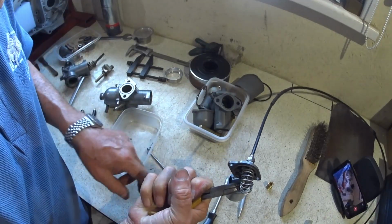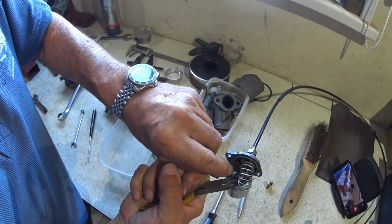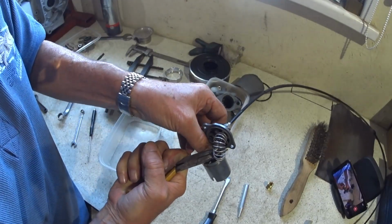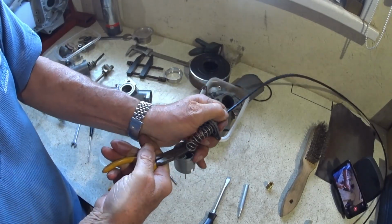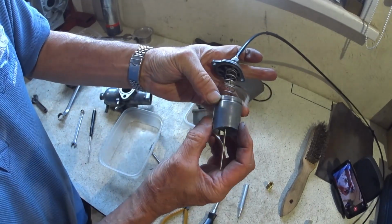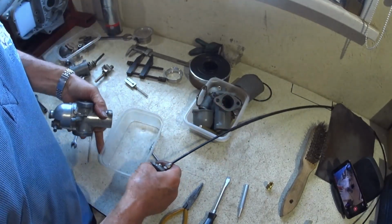And while we've got it now holding the spring as is, we have to drop in the needle valve because the spring holds that down, and that should just drop in there the right way around, he said. And we're in and seated, and now we can tease this off and let it sit down so it's trapped the needle valve and the cables nice and secured. We're in. So now we can fit the slide.